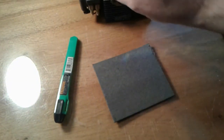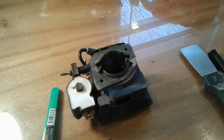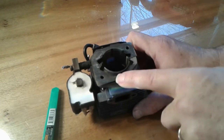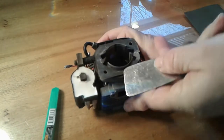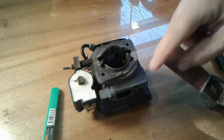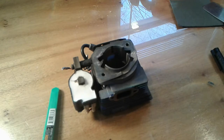Now this stuff is a sixteenth of an inch thick. I've cut a piece off right here. It actually appears to be a little bit thicker than what is on here, but I'm going to go with it anyway because that's what I have. Here's my strategy: I'm going to try to remove the old gasket — you can see how the other one broke, the section broke off. As I can't replace this gasket, I'm going to make a new one out of this material. My first step is going to be with this scraper — though that's going to be tough to get off. I may go get a razor blade; this putty knife is probably a little too thick. I want to try to get off as much of it as I can intact and then be able to trace it onto this piece of gasket material, because beyond that I don't really have a way of coming up with a gasket to put this engine back together.